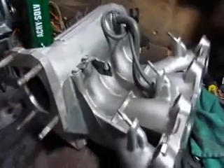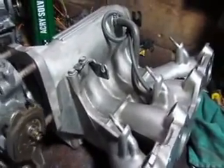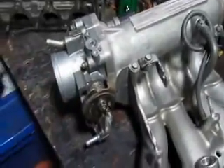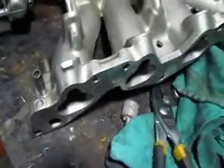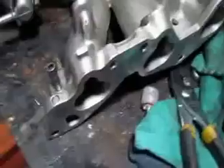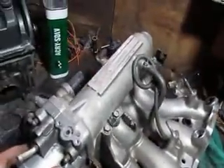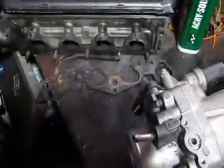While it's been off I cleaned it up a little bit — cleaned each intake port, and the inside I cleaned out after I got metal shavings in it. So there it is, a B-series throttle on a D-series manifold. Simple as that, not really hard. You're going to want to get yourself a new intake gasket because you're going to need to re-gasket that. I'm going to put a little gasket sealer — I always do, just to have that extra added safety. It's not necessary, but I'd rather be safe than sorry, and it always seems to work well whenever I do gasket sealer and a new manifold gasket — double the protection.